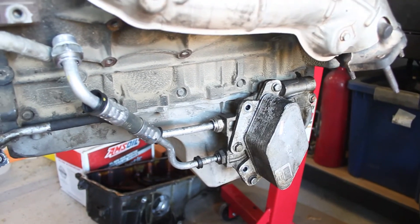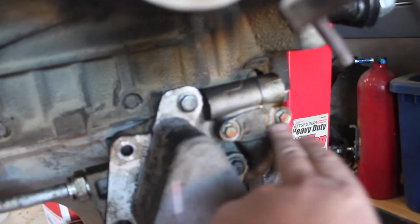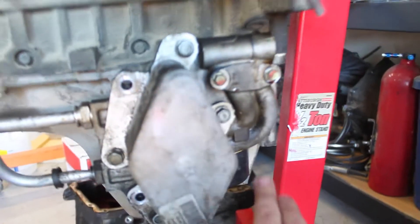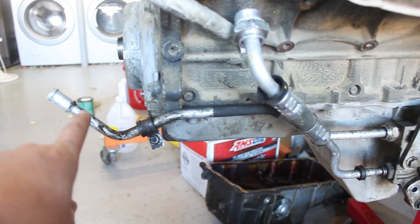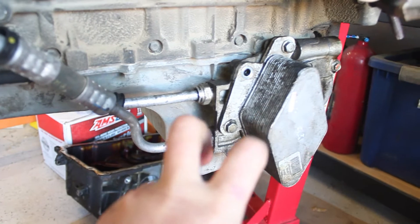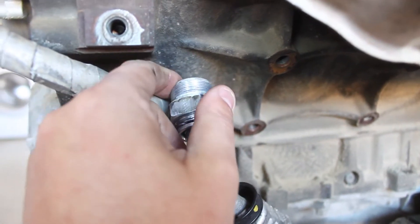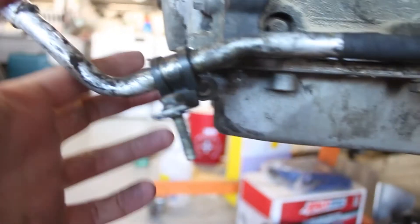It's a little hard to see in the Caprice, so I'm showing it on this other engine I have here. This is the oil cooler — as you can see it's bolted into the side of the oil pan. The oil will circulate through here, and you have these two coolant lines: one comes down from the upper radiator hose, goes through here, cools the oil, and then comes back up. On Gen 4 blocks there's a boss right in the side of the block where this threads in — that's where we just put the plug. You can see the clamp bolt is on this end of the oil pan as well, so it's a pretty simple system.